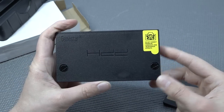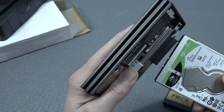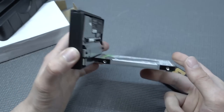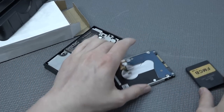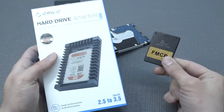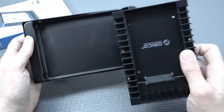The only downside is there's no network functionality, but this thing is ready to go. You can just plug in your hard drive and plug it into your PlayStation with the FreeMCBoot memory card. One thing to know is that if you put it in the PlayStation Fat it's going to wiggle around. I recently picked up something interesting — a hard drive adapter bracket sold separately, not cheap, but if you have an old 2.5 inch laptop drive it's a great option.